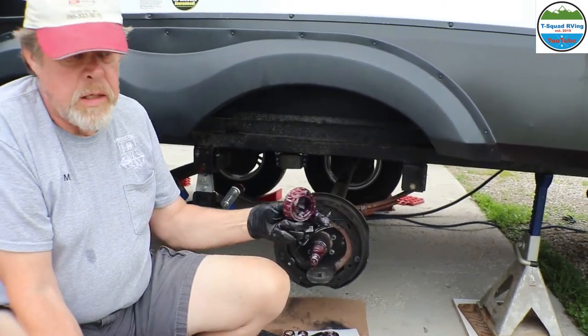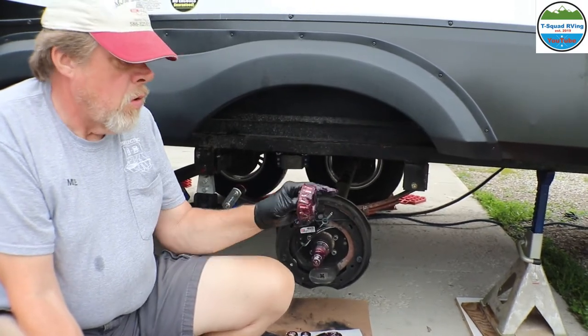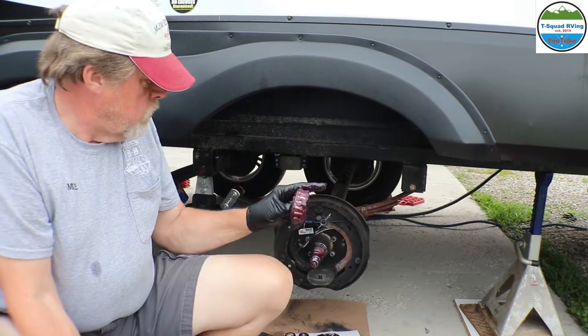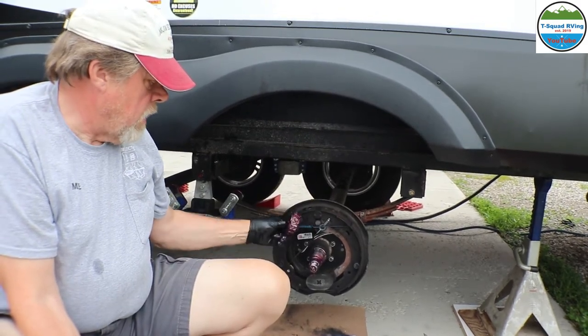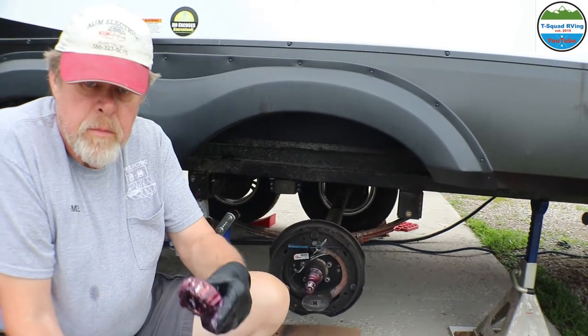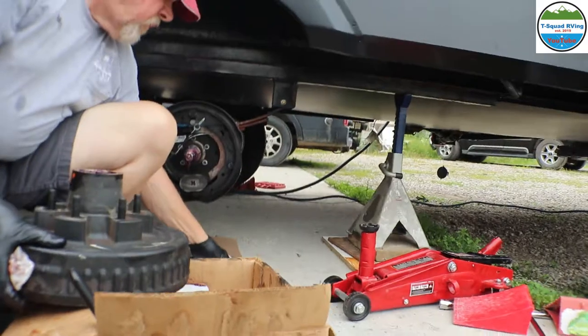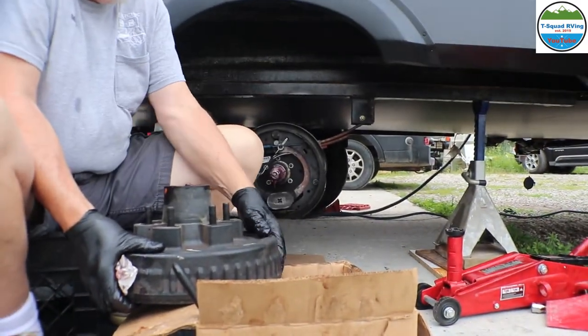Yeah. Because then this grease will make your brakes slip, so this stuff will ooze out into here and get slung around inside here. So it's always better if you pull this hub to replace that seal. Gotcha. I mean, for $3 or whatever it costs for the seal, it's just safer.